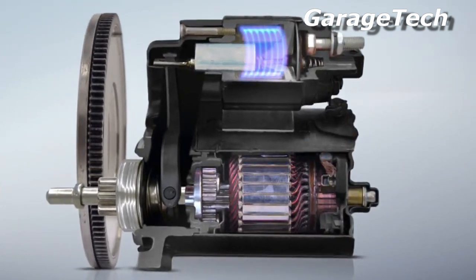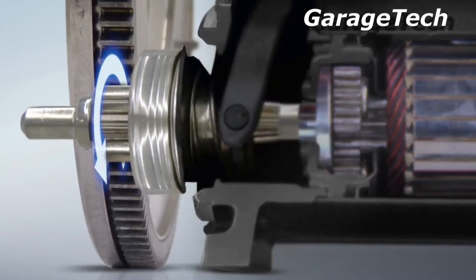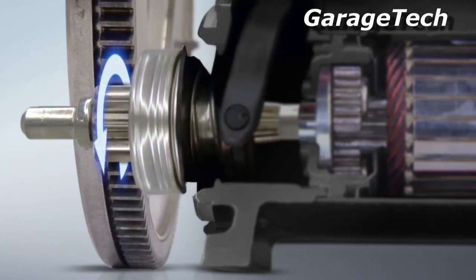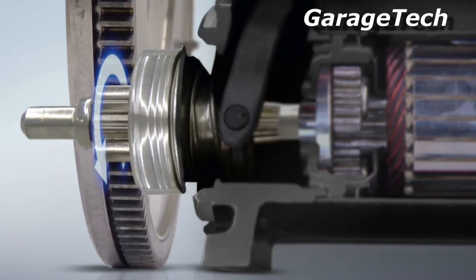The coil movement sets the lever mechanism in motion. The engaging lever presses the starter pinion in towards the flywheel ring gear — the toothed area around the outside of the flywheel. To prevent the pinion gear teeth from pressing onto and damaging the ring gear teeth, the pinion is driven by a thrust screw motion, meaning it turns as it's engaged. The teeth screw into the ring gear teeth gaps, allowing for smooth and precise engagement. This common type of starter motor is known as a pre-engaged thrust screw drive starter.